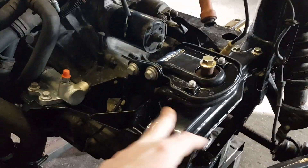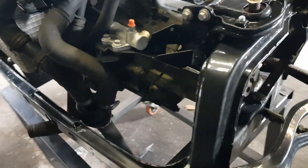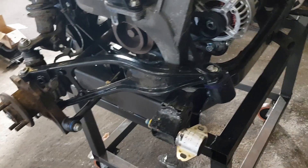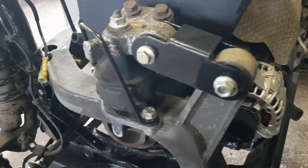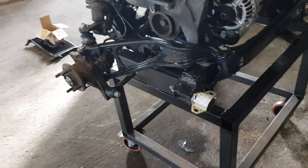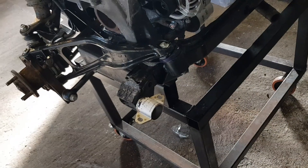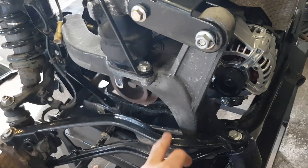Powder coating — Tonic powder coating — all these bits were powder coated off the car: rear arms and the subframe itself. Really good job — guys in Randallstown, Premier Finish, did mine — all these bits and pieces done. Really, really good job. Since I've been going to him now, he's using a different powder coating which is more designed towards cars — it's a bit more pliable, meaning stone chips won't just completely wreck it straight away. There's a bit of give to the paint, so hopefully it'll last a lot longer. Obviously the rear of a TF gets a lot of abuse, so having something to protect the metal is a good job, especially the subframe.